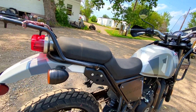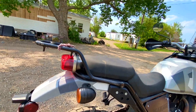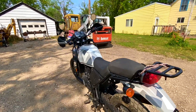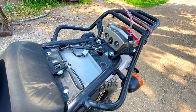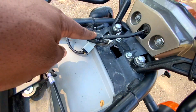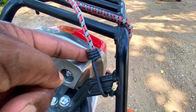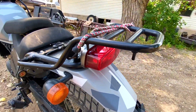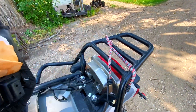Thankfully it worked — you can see that's activating the brake. It doesn't seem very bright on camera, but it's actually bright and when the bike is running it's much more visible. To get to the brake light, there's a zip tie you cut, then unplug a 10mm connector, push back, and there are two Phillips screws that get exposed — then you can get to the bulb. Pretty straightforward.